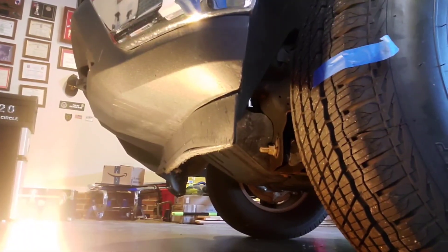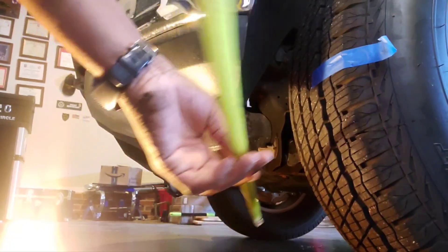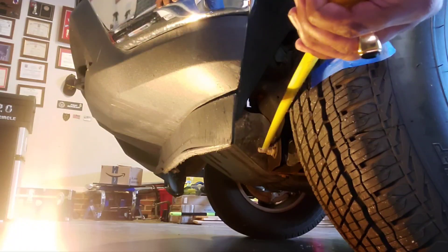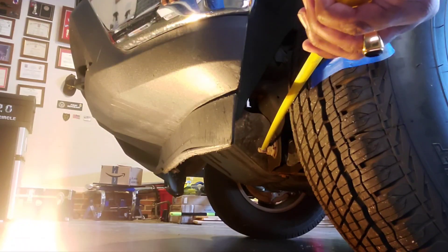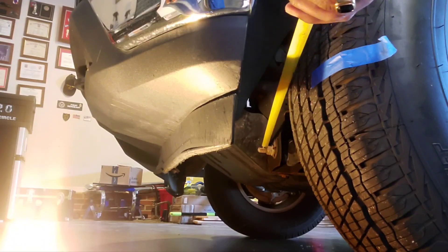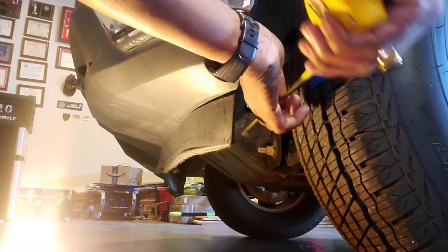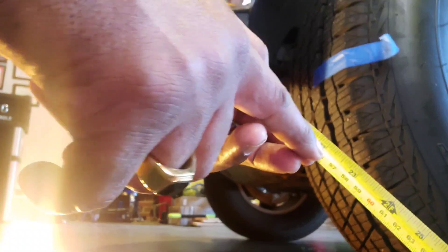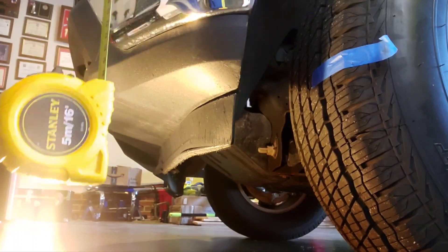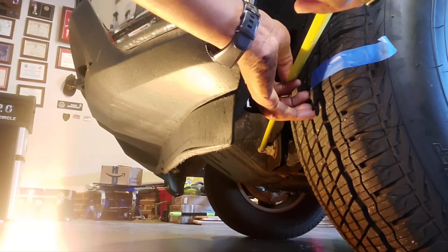This is extra: if you want to check to see if one wheel is off, the best way is to find your measuring point somewhere on the lower frame and measure to a point on the tire. I used the bolt coming through the upper A-frame suspension and measured to a point — that was 22 inches. You do the exact same thing on the other side, and both of them should be 22 inches away from a solid point on the frame.